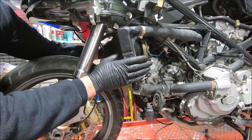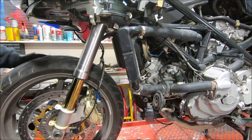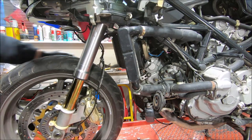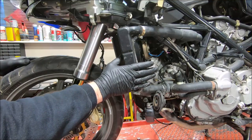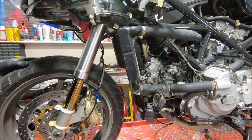Just put your hands on the radiator, both sides, while it's warming up, and just see when you feel heat in the right hand tank, and if that's before or after — or how much after — you feel heat at the bottom on the left hand tank.